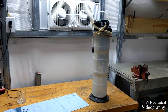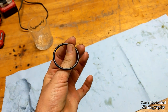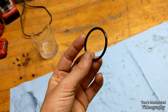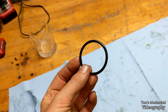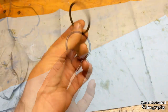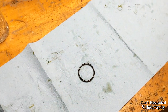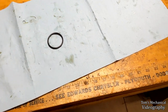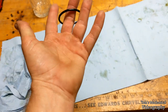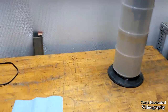That did precious little. I can only assume this o-ring is bad. I mic'd it out and I'm pretty sure this is metric because the other ring was not SAE. The imperial measurements I got were one and 19/32 inches internal diameter and 5/32 inches external diameter - but that could be either a 40 or 41 millimeter ID with a 4 millimeter width. I'm going to look online for a standard size close to that, whether metric or SAE, and also go to the hardware store and poke around.